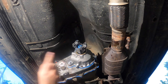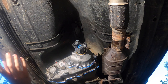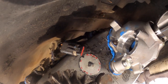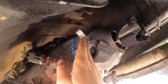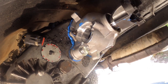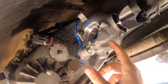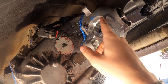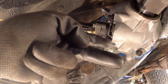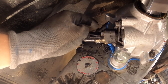Repeat the same process on your front shaft, then let the RTV seal for a minimum of one hour before filling with fluids — I'd recommend more than that, I'm going to let it sit overnight, especially if it's not at an ambient temperature of 70 degrees. For reinstalling the speedo gear, remember the picture you took of the orientation — it affects how you'll read the speed. The gearing on the end of your speedo, orange for mine, comes in different gear ratios for more accurate speed depending on aftermarket tire size. Reinstall, clip it back, and make sure the prongs are pushing in onto the speedometer ring, then reinstall the safety attachment mechanism.